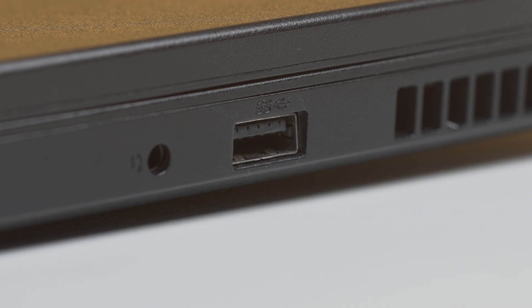The answer is yes. You can plug the charger into any USB type port using the provided cable and charge your batteries. However, the charging is going to be much slower than if you use an adapter that supports quick charge. In most of today's laptops you will find the USB 3.0 port, marked as SuperSpeed or with a blue collar. Those ports can provide up to 0.9 amperes, whereas the compact charger can charge up to 3 amps.